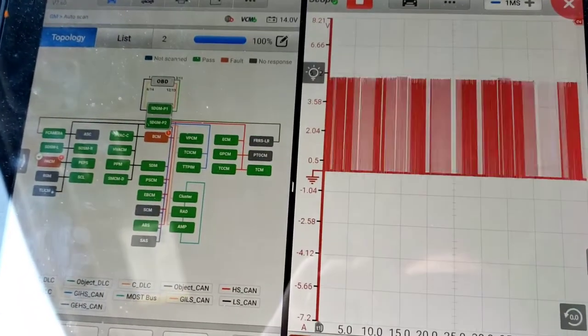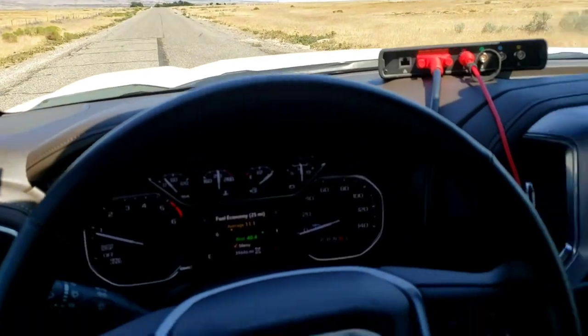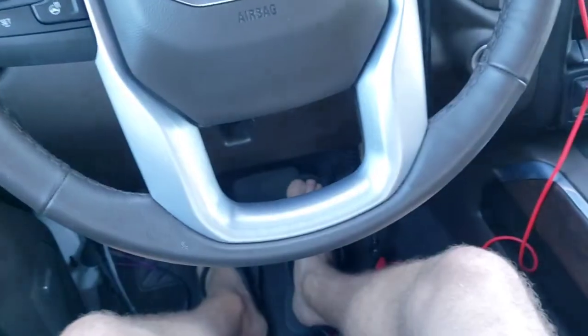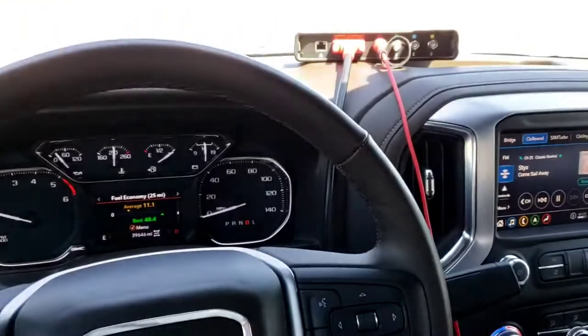We're going to drive it back to town, look at this, hook it back up, and go from there. And I'll show you in the schematics what I'm looking at. That's the only module in this vehicle that's on the outside of the truck for this low-speed CAN bus. Everything else is inside. We're scoped down here. We don't want to open up any circuits or pull modules that we absolutely don't have to.